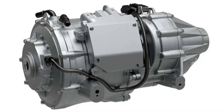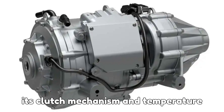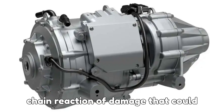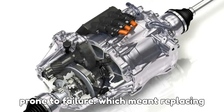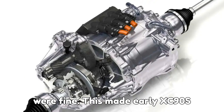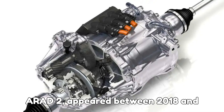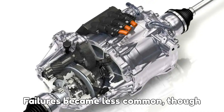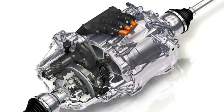Let's look at the three generations of ERADs. The first version, ERAD 1, came with the 2016 to 2017 Volvo XC90. This one had serious issues with its clutch mechanism and temperature sensor. When the clutch wore out, it sent metal flakes into the fluid, creating a chain reaction of damage that could eventually destroy the motor. Worst of all, the embedded temperature sensor was prone to failure, which meant replacing the entire ERAD even if the mechanics were fine, making early XC90s especially risky. The second version, ERAD 2, appeared between 2018 and 2022. While very similar in design, Volvo did strengthen the internals. Failures became less common, though issues like weak C-clips and noisy sensors still cropped up occasionally.